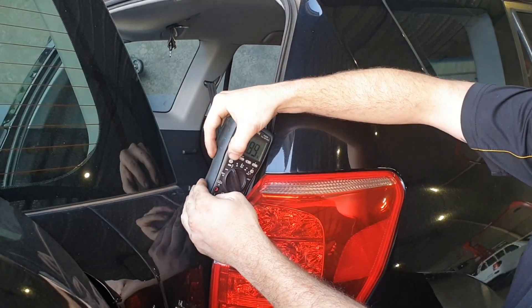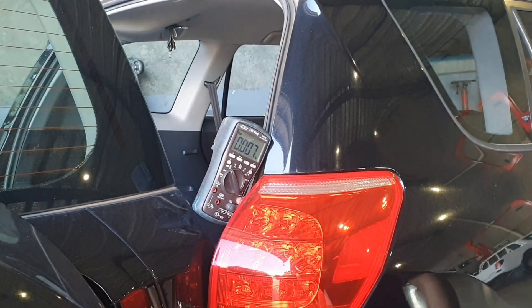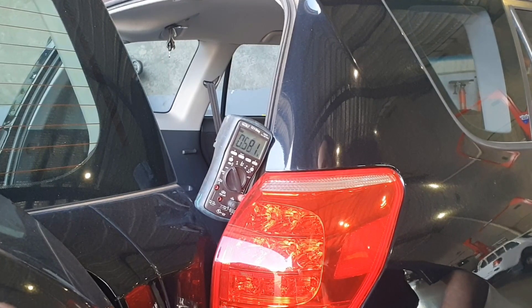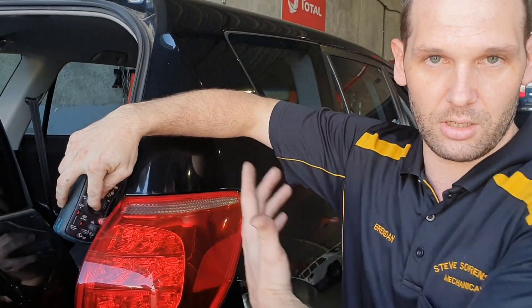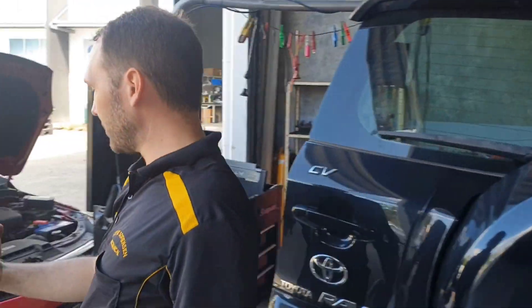We can change it and put it on AC voltage instead. On AC we've got nothing, and as I spin the wheel we get an output. The sensor is working — it's a valid test if you don't have a scope. By getting that 10 volts you've also confirmed the integrity of the circuit from the module up to the sensor.